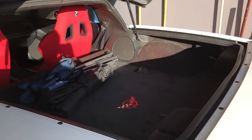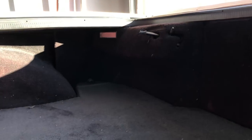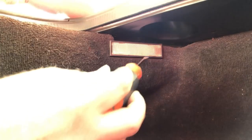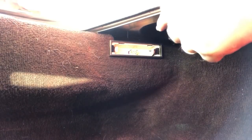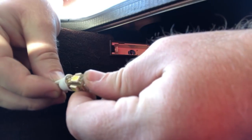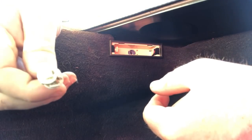In the trunk area there are two lights, one in each corner. To remove them, take your flathead screwdriver and put it between the black plastic and the clear lens and gently pry it until the lens comes out. That will expose either your stock halogen bulbs or a replacement LED. In my case I do have an LED in here but it's not working — it looks like it's broken — so good thing I have some replacements.